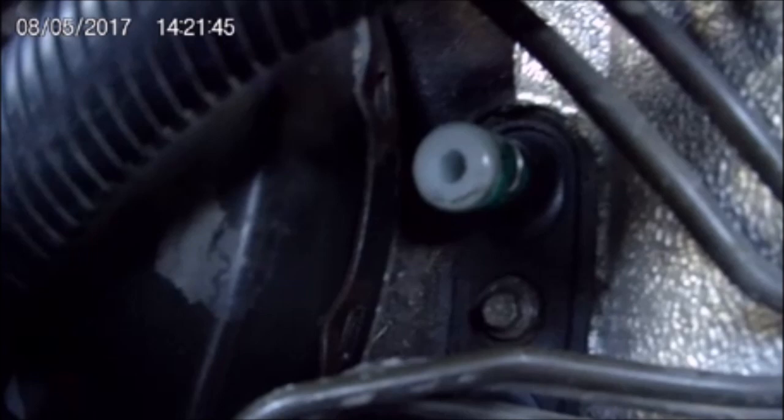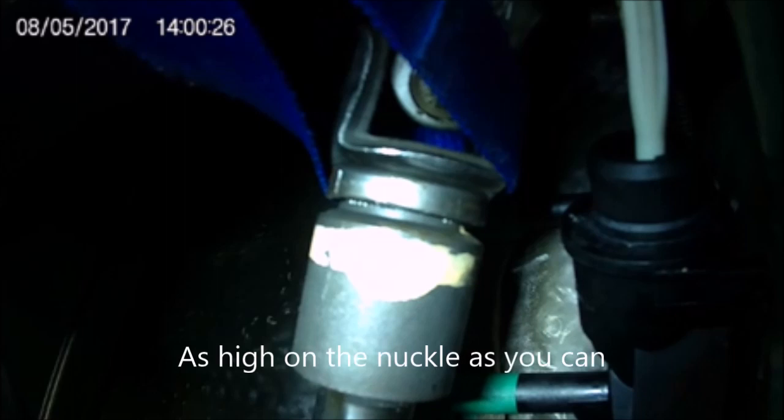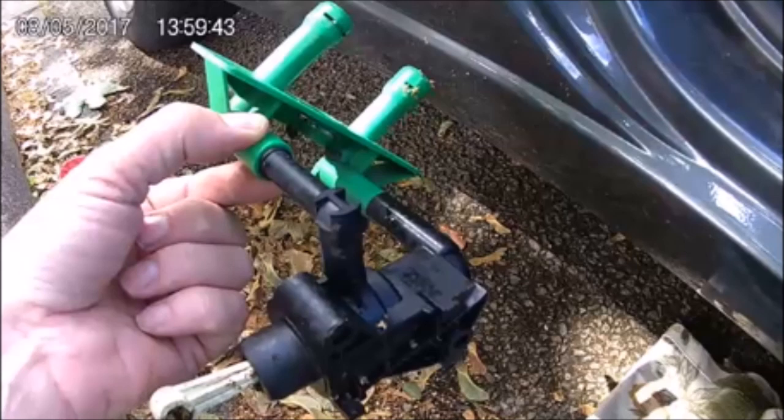Then you've got the little 8mm bolt - take that out. Then go inside the car in the footwell and ratchet strap the steering column away as best you can. You'll work at it with your hands until you feel it's far enough. You've also unclicked it - there are two little locking pins, two little plastic things just sort of hooking into the pedal assembly, which you'll use when you align it again later. But they're quite grippy so I did have to get up behind and give it a little bit of force to lever it forward and pop it off.